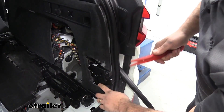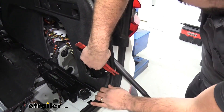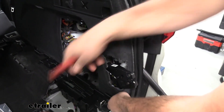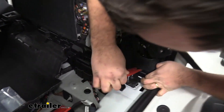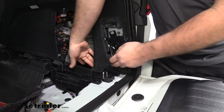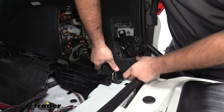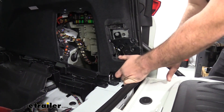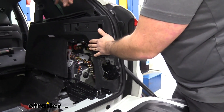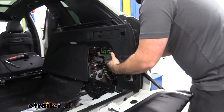To get this side panel off, you're going to see our latch is kind of actually in the panel itself, so we're going to have to loop this around it to get it to drop out. Peeling this back, try to get this portion at least outside of the weather stripping. You also have this plastic down here, so we're going to try to pry and work it out. Just kind of moving this plastic — it's a separate piece — to get that lip out of the way and allow us to work this a bit more and get this portion out.